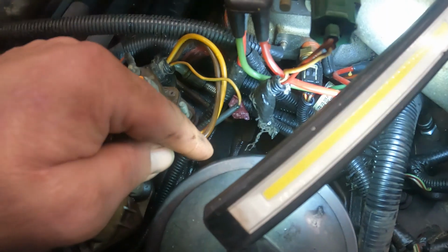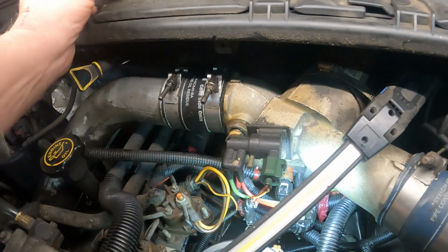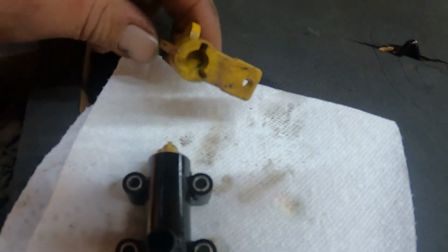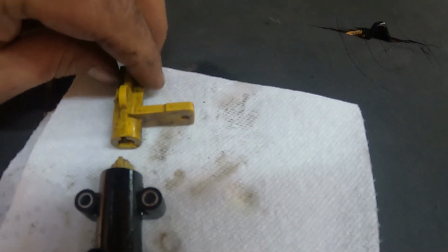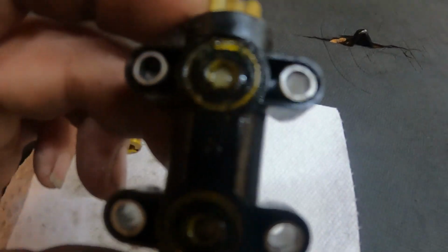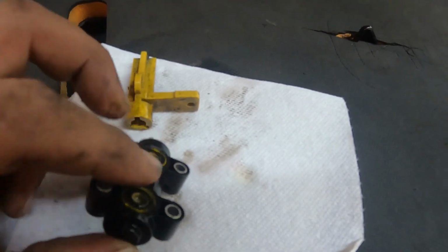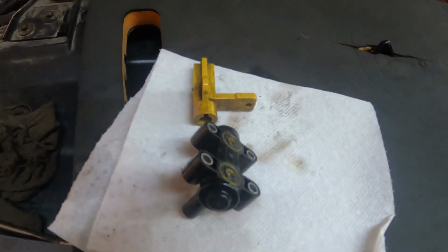Like I said, you got the four bolts loose. They're just little ones like this, T20. And then this is what it looks like. This comes off. There's only one way this can go on, so you can't make a mistake and put this on the wrong way. And then these are the O-rings, and look at that. These look pretty flat and worn out to me. So alright, I'm going to grab a pick. We're going to remove these O-rings, and then we're going to clean it up, and we'll bring you right back. Here we go.